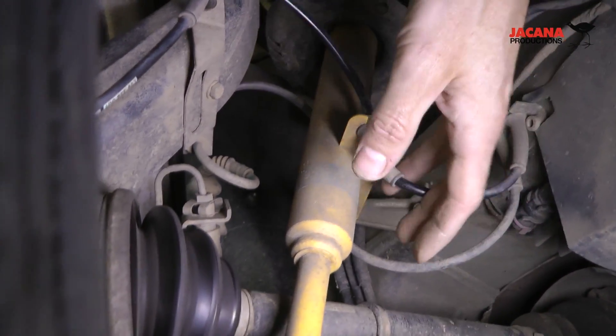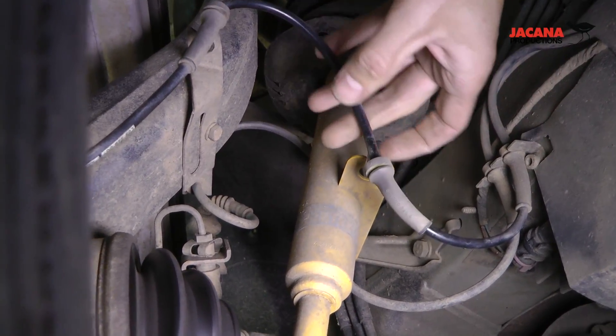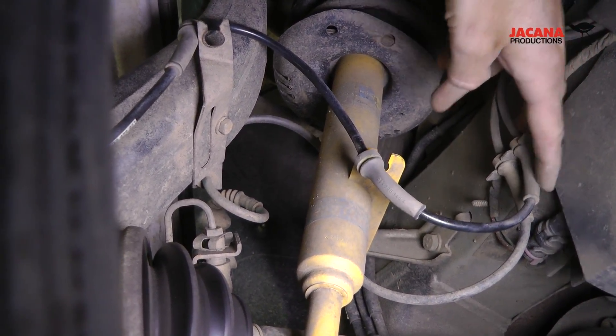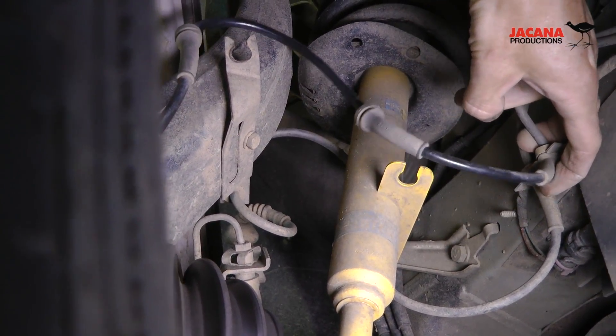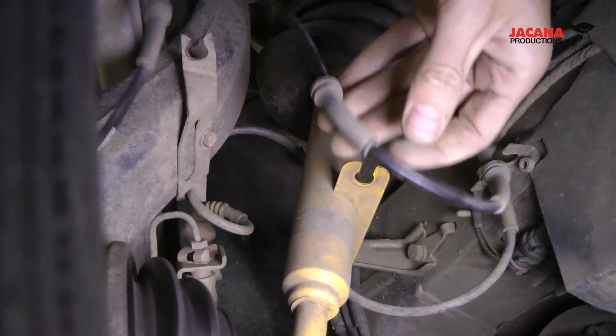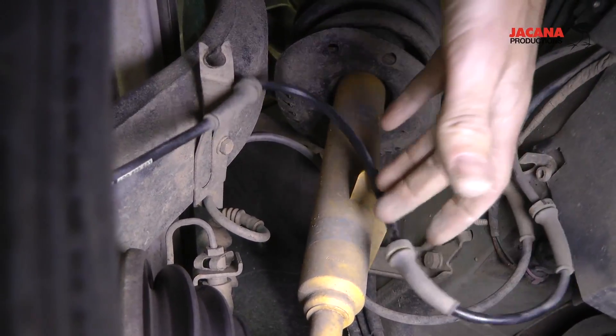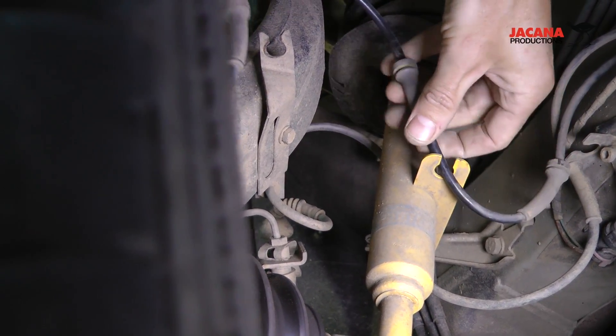I knew the problem was on the right-hand side of my car, so in the picture I disconnected the little grommets for the ABS wire and drove around the block. Lo and behold, no more ABS light blinking, beeping, flashing lights, brake lights, ABS lights — everything was fine. So that means turning the wheel actually stretched that wire out, and there was indeed a short in that wire somewhere.